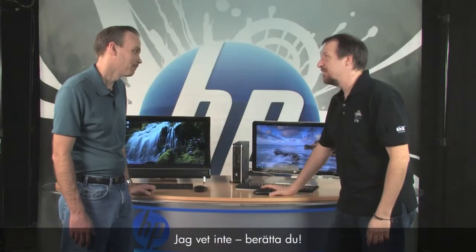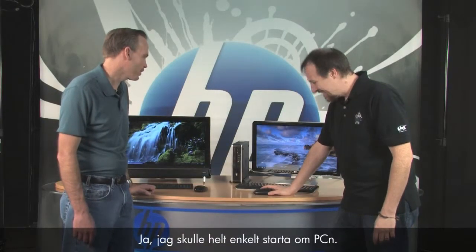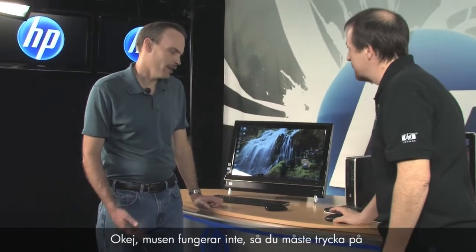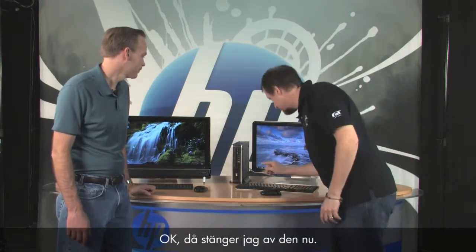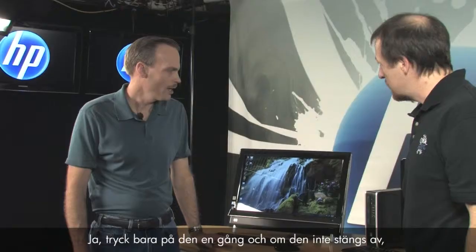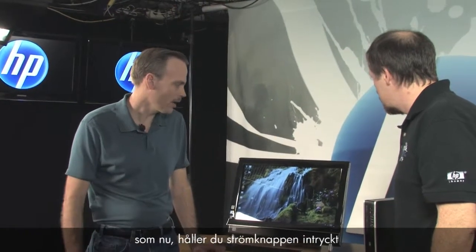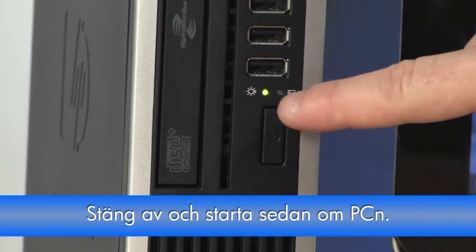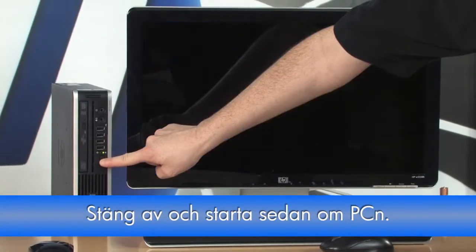What do you do next? I would go ahead and restart the PC — maybe things are just locked up. But how do you do that if the mouse isn't working and you can't press Start? You'll have to press the power button on the front of the PC. Press it once, and if it doesn't shut down, press and hold the power button for five seconds or until it turns off. Your PC is up now — still not working?